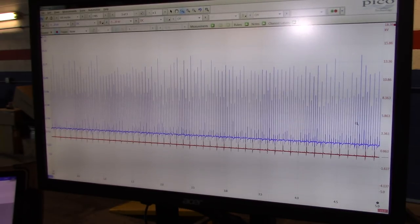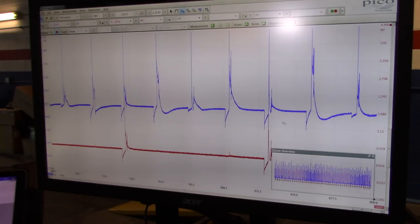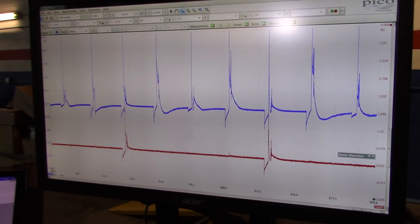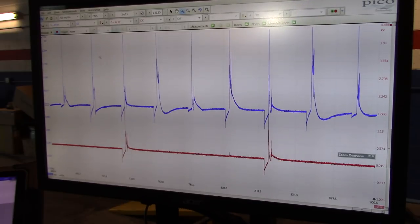I haven't removed anything yet, so let me stop the video and swap the coil first, then restart the car. Actually, before I do that, let me go to the end of the capture to see what's happening there when the car is not producing a misfire on the scanner and I couldn't feel it — but that doesn't mean the oscilloscope isn't still picking it up. And it's definitely still there.